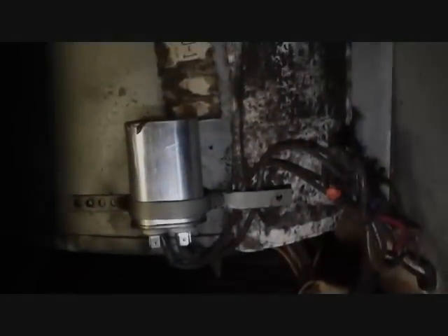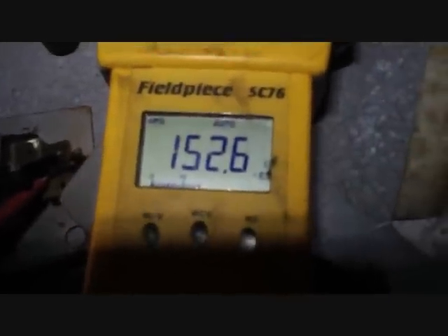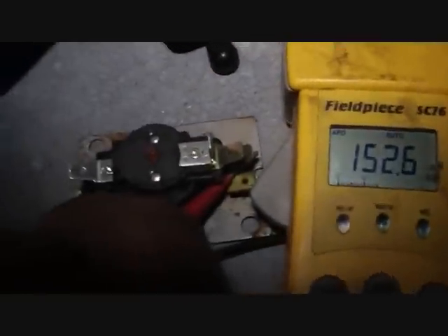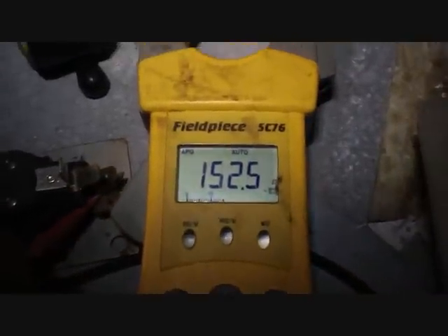She is alive! One good relay and now one happy fan motor, one happy customer. The old relay's resistance was about half of what it should be, if not a little less, on these type relays — that's what happened.